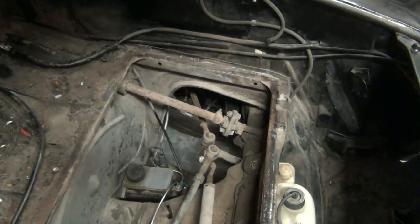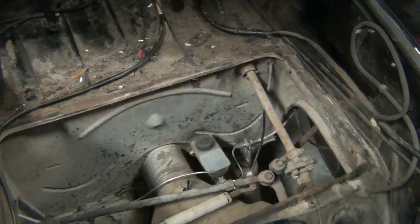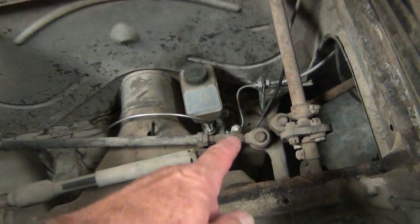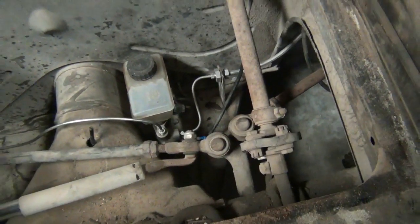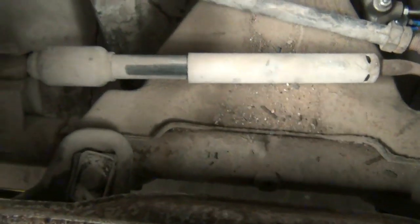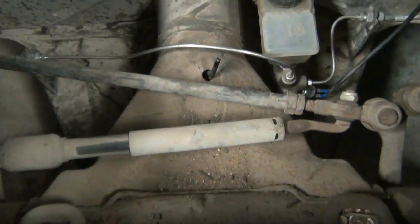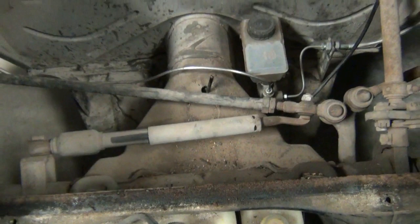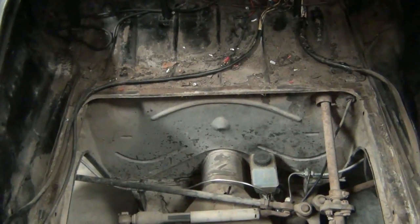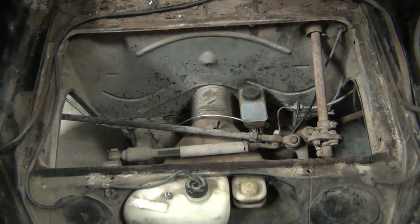Take note — I told you that the cells would be slightly off-centered. With the number of cells we're putting in front here, they're not going to be off-center too much, but the reason for that is the steering column. The battery box will sit right on top of the body tabs that mount to the twin torsion beam bars or tubes, and it will be bolted in place where the existing mounting points were — there are four bolts.